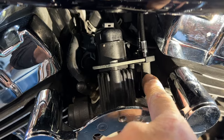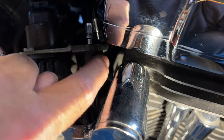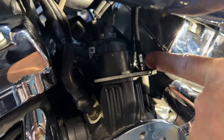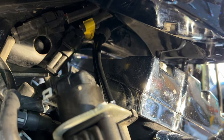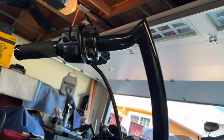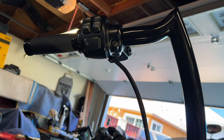So you can see this little barrel right here — it has a slot on the side there, that little slot where you pull the cable through and around. And this is your idle cable right here, and it has that little spring in there. The throttle cable is the one in the very back. You can see how they're both through that little loop right there, and that's just extra support to keep them in place. If that wasn't there, I'd go ahead and put a tie wrap on them so that they could be secure. And they're just coming out and hanging right there. So I mocked that up — that is the lights, the trip, and the horn, and the blinker, the flasher.